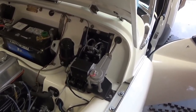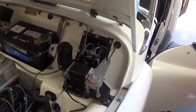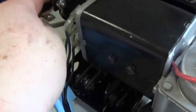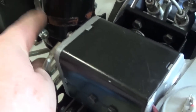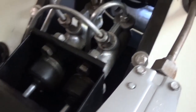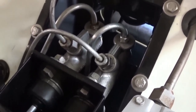We've got it all hooked back up. Now to check if that's fixed the little weep in that fitting. I did have to position the fluid reservoir up a little bit as this line is slightly taller than the other one, so we'll need to touch up the fluid reservoir with a little bit of black paint. Everything's tight - let's put some fluid in it, bleed that system, and see if we've fixed our leak.